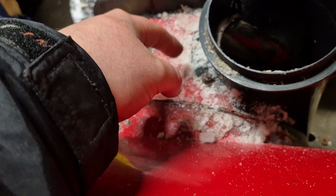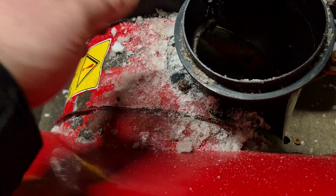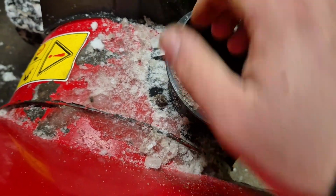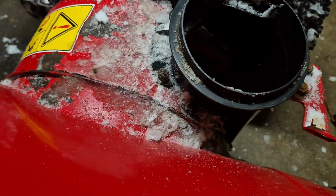And these ones you might actually have to cut off with a grinder, because these like to rust on here for some reason. I don't know why. But yeah, they're also carriage bolts, so you can stick your hand in here to hold up the bottom side when you take it off. And it's a 7/16 socket, by the way.